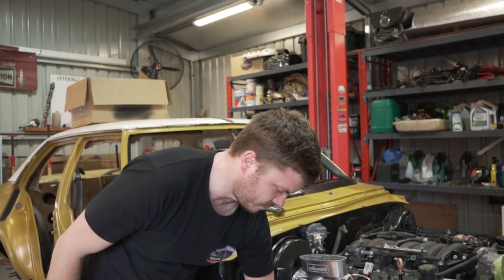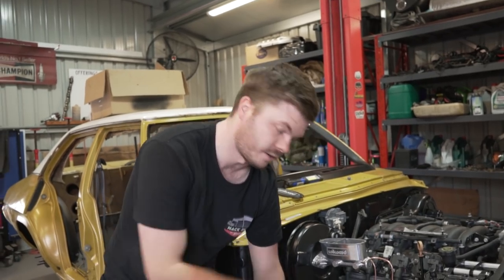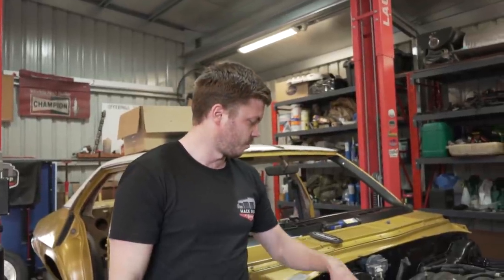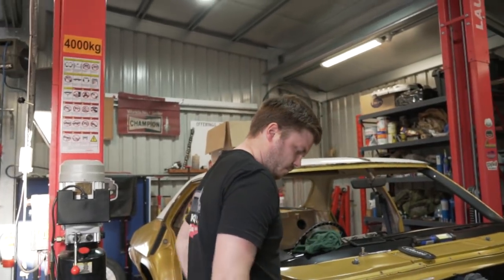Yeah, there's a slider. There's one that slides. Yeah. We then went around, bled the inside, then bled the outside on each one going around. And that seems to have made the difference. So there's a lesson learned for us. We didn't realize that you had to bleed both sides. So feels awesome now. It's a good pedal feel. So we'll put the cap on this because that's done now. Yeah, we'll put the wheels on and see what it does. Yeah, go for a spin around the block.